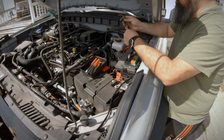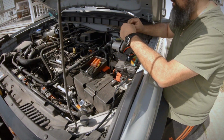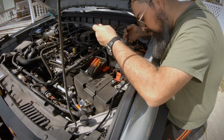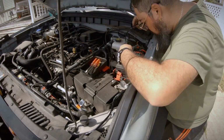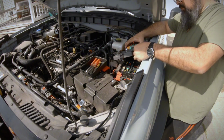The final step is to wire the amber grill lights. The lights can be wired to the fuse box with the supplied kit. When the Bronco is on, the grill lights will turn on. If you have the factory switch panel, the lights can be wired into it so you can control when the lights are on. My Big Bend didn't come with a switch panel from the factory.